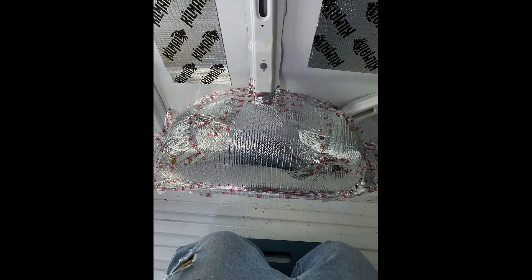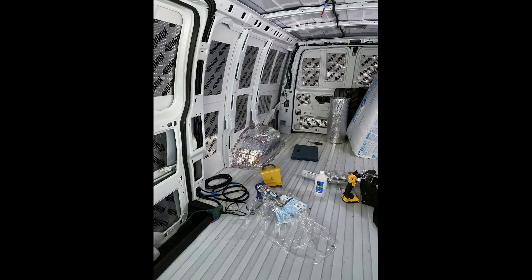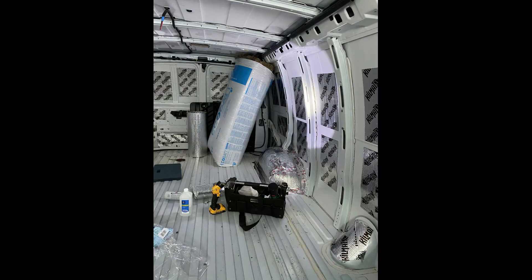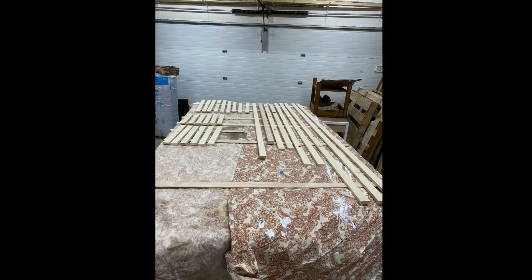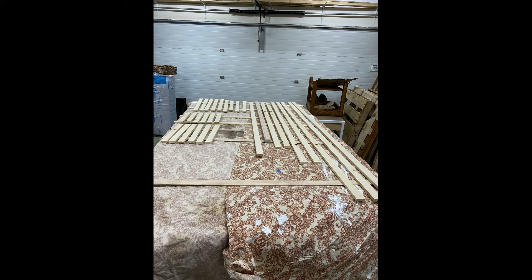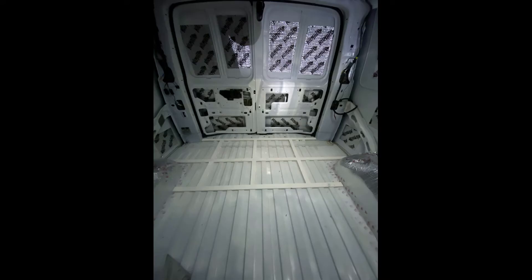I was eager to get the flooring done, so I hurried to insulate the wheel wells and the area around the fuel tank using Reflectix and foil tape. I did apply sound dampening mats to the wheel wells prior to putting the Reflectix over them. For the subfloor, I used boards that are half inch thick by inch and a half, and I painted every board with mold resistant primer on all sides with a couple of coats.